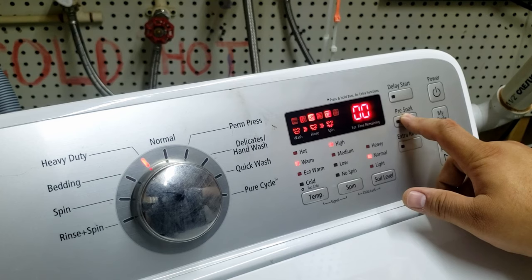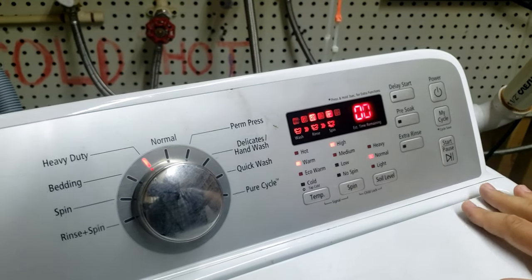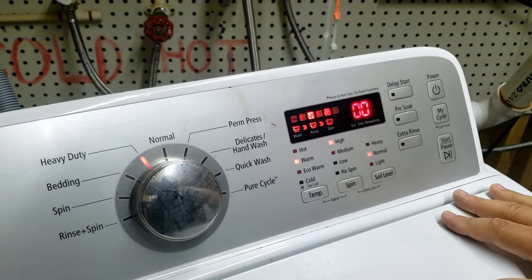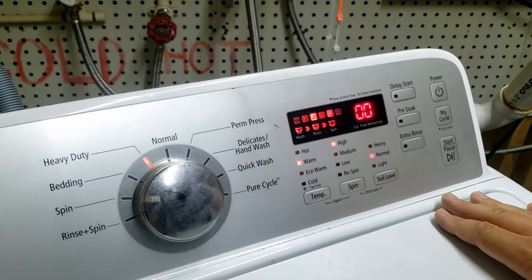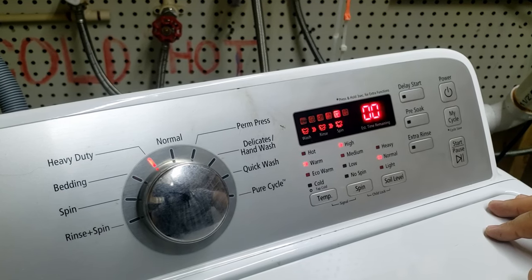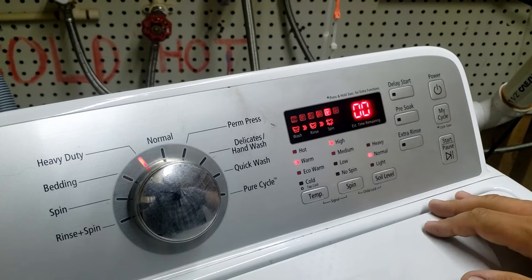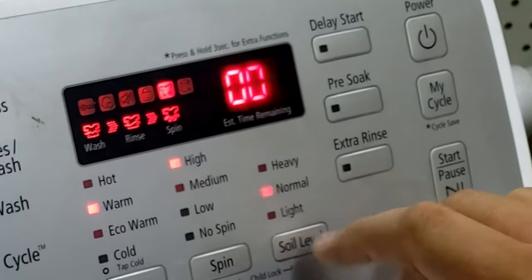On this unit, I'm not getting anything for the number of washings. This unit has been plugged in and out multiple times, and I believe the wash count may be saved in short-term memory that requires continuous power. Since I deal with used appliances and we plug it in only once or twice, it may not retain that count after power loss. That's something to note on this type of washer. We can also check the software revision to see if the unit has been updated — maybe your issue requires a software update, which would likely need a service tech to perform.